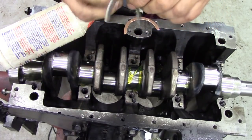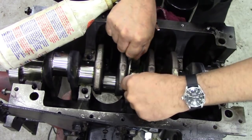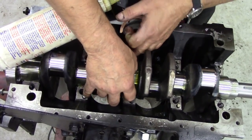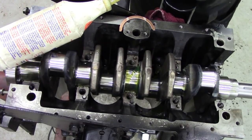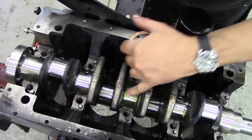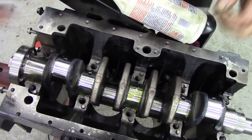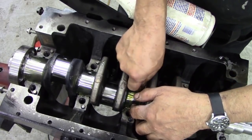You see the copper face? The copper face has got two grooves in it — those go to the outside because there's a bearing surface on the inner part of the crank. Stick them on the sides like that, if you can, and then turn them. Put the crank this way a bit, push them down, and turn them like that. See? They're locating themselves. Now what we don't want is any oil in these thread holes, so we've got to be careful and we've got to get a wriggle on. Make sure it's nicely coated. It is a messy, tricky job.